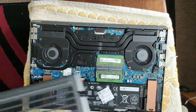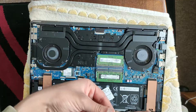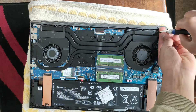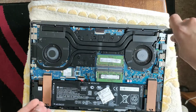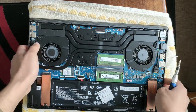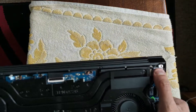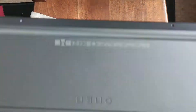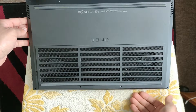Actually, it's not all good — I forgot something vital: the heatsink screws. They go here and here. Good thing they sort of kept the heat sink from falling out. Always check that you have put all your screws back — you'd think after so many times I'd remember, but no. You may get confused about which screw goes where: there are two screws on each side, but this one goes on the inside for the heatsink, and the other one is for the actual cover. One thing I should test is the fans — let's see if they work. Both fans are working, they're definitely rotating, and air is going through.